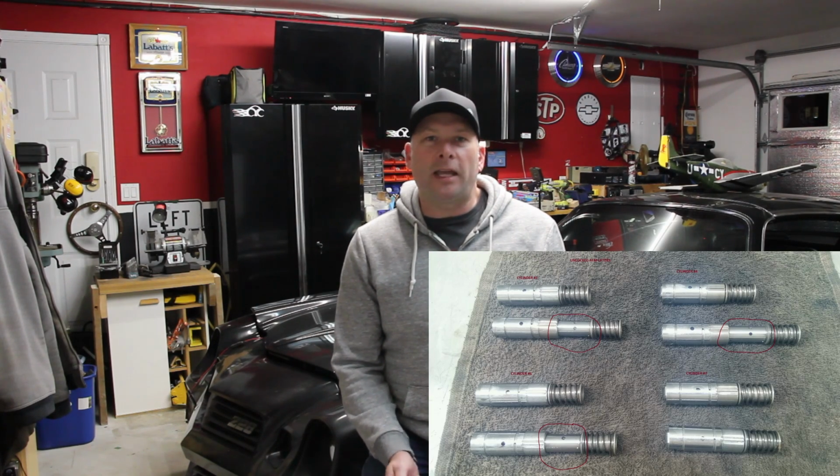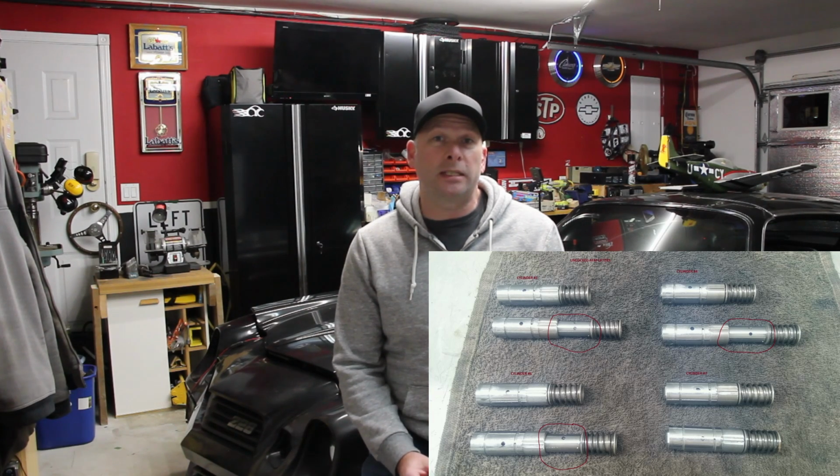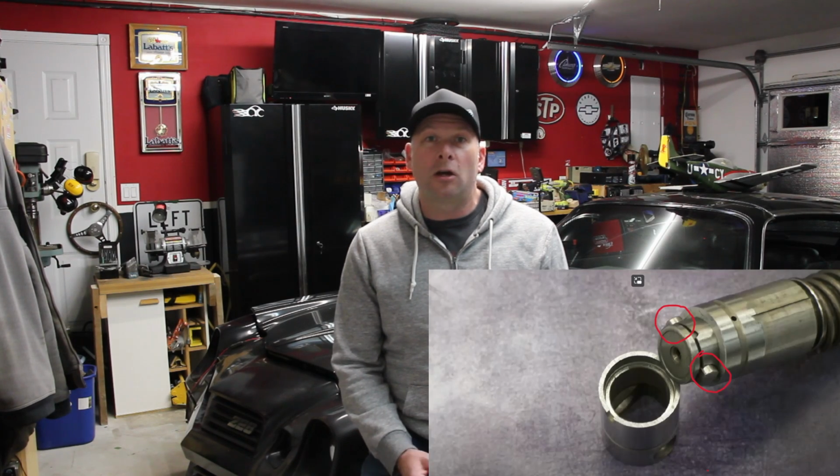And as you can see here, the lifters have a special inner and outer body that are basically separate pieces, but can be locked together. When they are locked together with these pins in this area here, the pins create the one-piece lifter, which is like a conventional lifter. When the oil is supplied to that area of the lifter, those pins are retracted and the inner body and the outer body are free to move separately. This is where the lifter collapses, and this is where those cylinders deactivate.